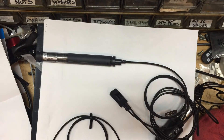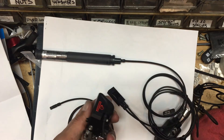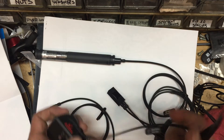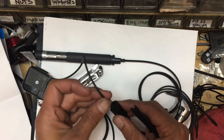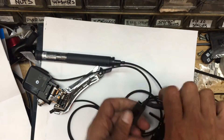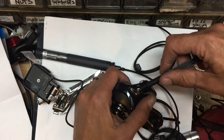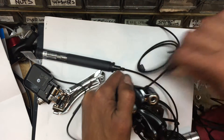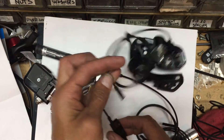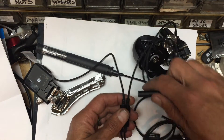Plugging the battery in — having the battery come unplugged or not plugging it in all the way — is probably the biggest mistake or issue as far as having one that inadvertently works or doesn't work. That's a pretty common error with shipping a bike or travel, not getting that battery plug quite in all the way at the battery itself. So I've got my two derailleurs, the battery, and then the long wire up to the A Junction.